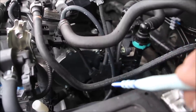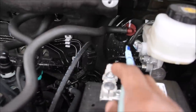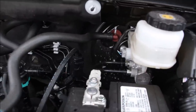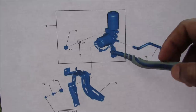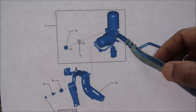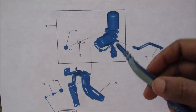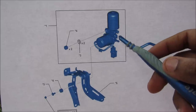The EVAP system uses its own vacuum pump in order to perform leak detection. In the hybrid model there is actually no vacuum pump nor a brake booster — it uses an electronic stroke sensor and actuator to actuate the brakes because it has to work in EV mode where there won't be any vacuum. The electronic brake booster uses an electric motor and a stroke sensor to sense how much you've pressed the brakes and to assist in pushing the piston in the master cylinder. This negates the need for a big brake booster and vacuum pump and also allows more fine control of the braking system for autonomous features.